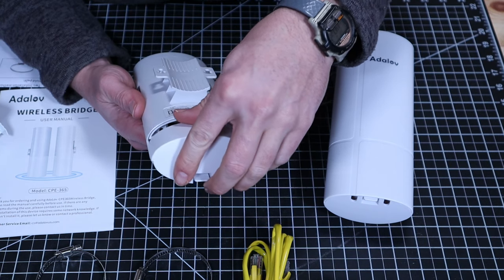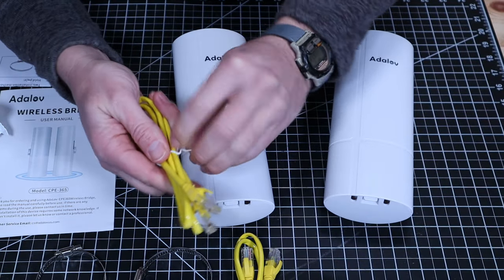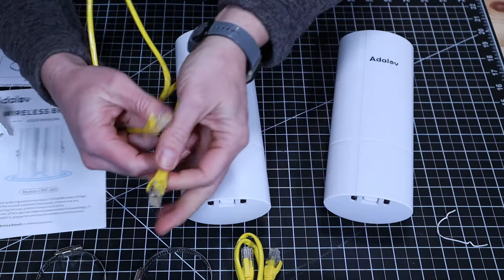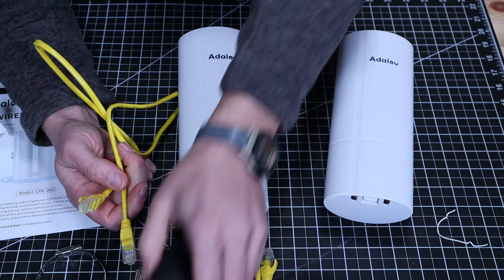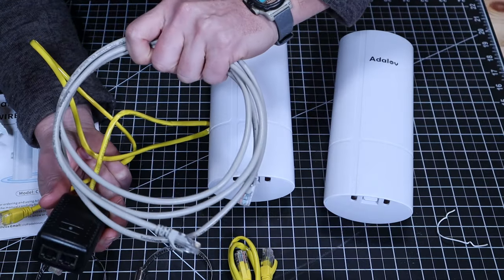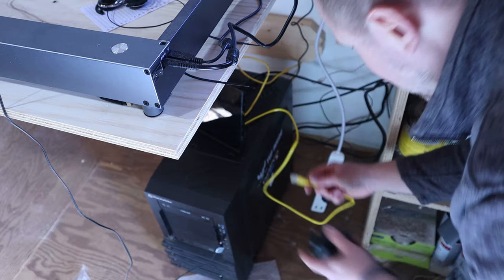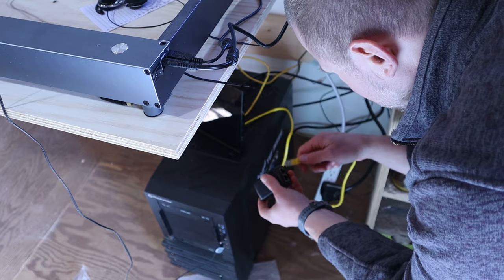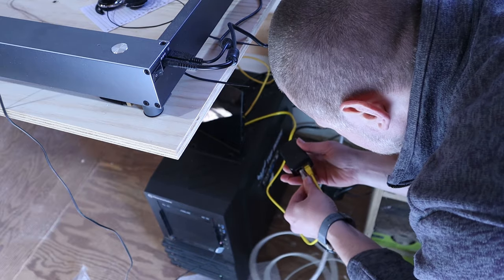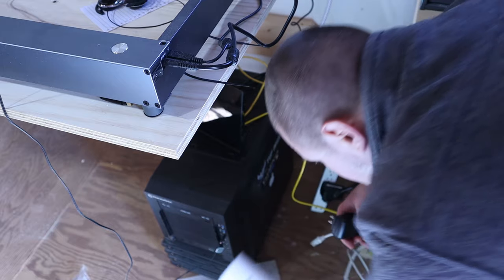These should be pretty simple to get plugged up and working. This cable goes from the unit to the PoE injector — that determines how far you can reach a power outlet. From there you can run a longer cable to connect into the bridge. For instance, this one is about seven feet. The first thing to do is connect the LAN side — as labeled on the front — to the wireless router. Then the other side, the PoE side, takes the longer cable and that connects to the wireless bridge.